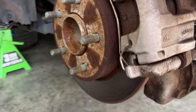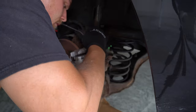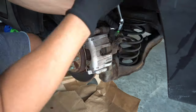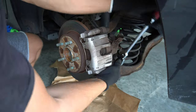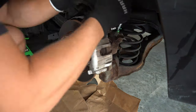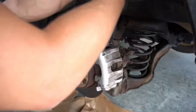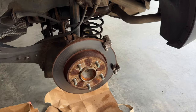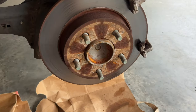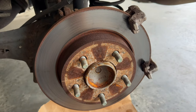Once all four bolts are out, we can take the hub off. A good habit is to WD-40 your caliper bracket bolts first so they come off easier when it's time. First thing we need to do is unscrew the caliper slider pins, which is a seven millimeter hex bit. Once these are both removed, we can move the caliper out of the way, making sure not to hang it by the brake line. I used an S hook, but a zip tie can work too, then remove the brake pads. You can now actually hear the sound of the rear bearings — they are 100% totally bad and need to be replaced.